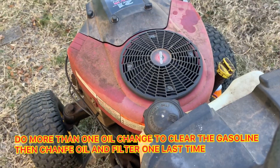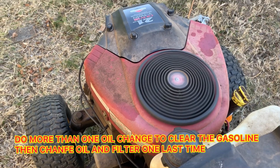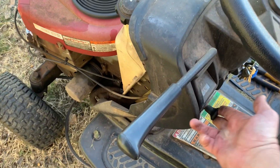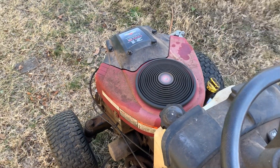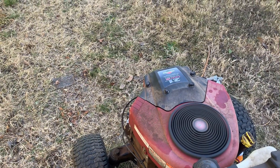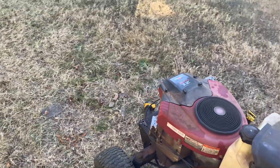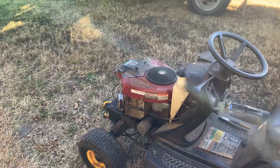The motor's on its last legs. Let's go ahead and choke it and see if it'll pop off. Yeah, it's probably got some valve issues too. The crankcase was full of gasoline — that'll make one run like it's rich.